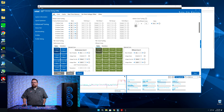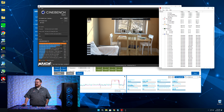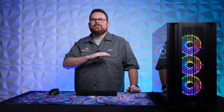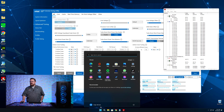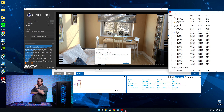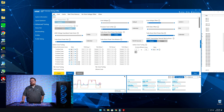That seemed okay. A little bit more — let's go to 5.7 all-core. We didn't see any throttle, but temperature-wise we saw 92, then 97. This might be a little bit much for our cooler. Even though we saw temps at 96 or 97, in gaming our temps are going to be absolutely fine with that overclock. So we're running 6 GHz on one and two cores, and 5.7 on three or more. We're at the edge — we didn't crash. Five-six across the board. There is our overclock and we're good. We're locked in.